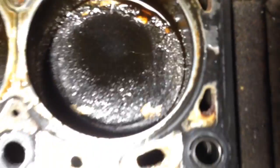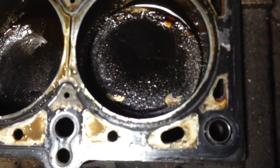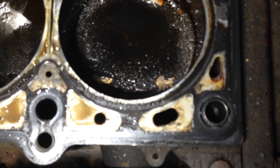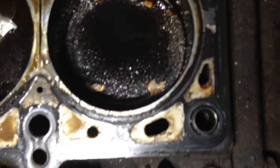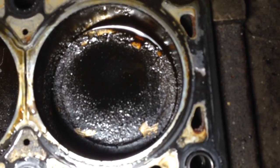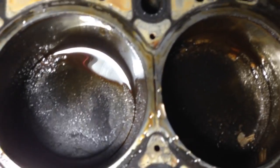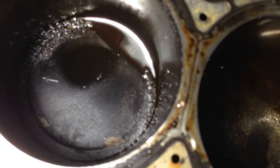Because I'm going to focus down in here — there's the kissing marks on the carbon. You can see the two shiny spots; those are the intake valves making their close encounter of the third kind on the piston. This one here — no such marks. This one here, you can see them there, the two faint marks — so those are wasted.